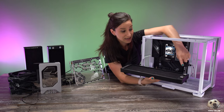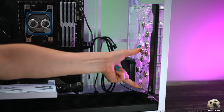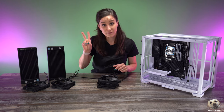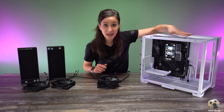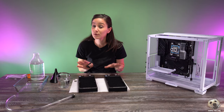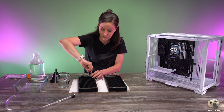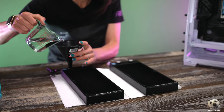One might think: why not flip the radiator so the inlet and outlet is closer to the front? But we're installing the distro plate onto the front and there's still not enough room to access those ports. So I've decided we're going to use two 240mm radiators — they'll both have two fans on them. One will be on the bottom, one will be on the side, and both will be intake. Then we'll put three fans directly onto the case on top as exhaust, along with a fan in the back which will also be exhaust. Before you install a radiator, you should flush it out with hot distilled water. Close off one port, add water to the other side — the SE 240 takes about 120 milliliters, so very little liquid.